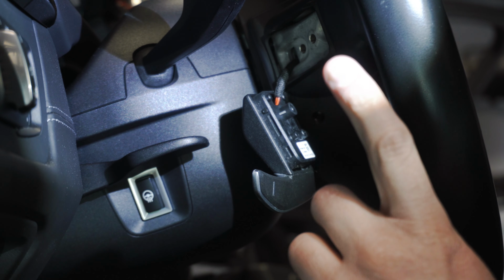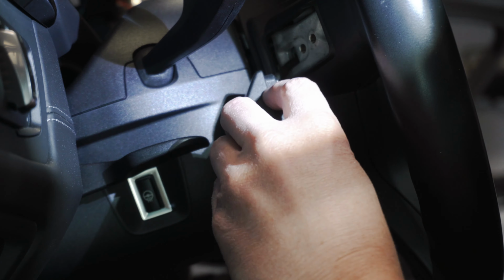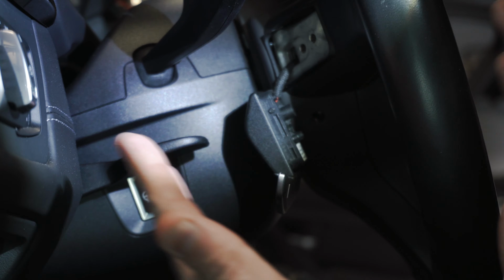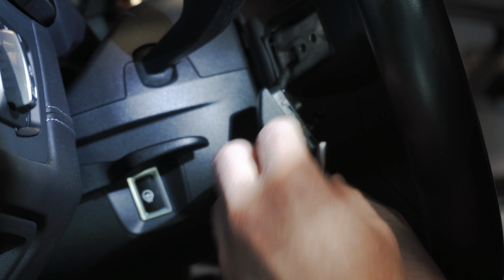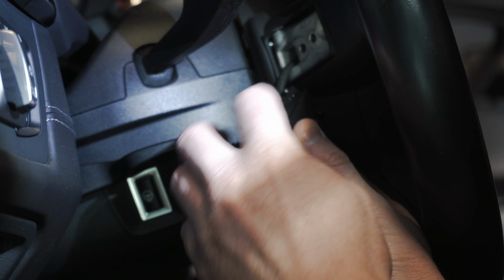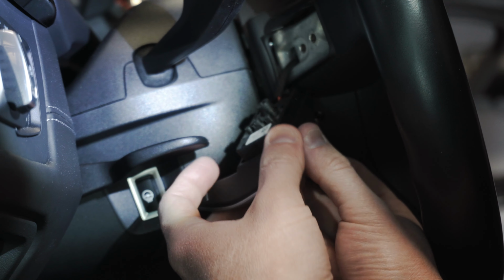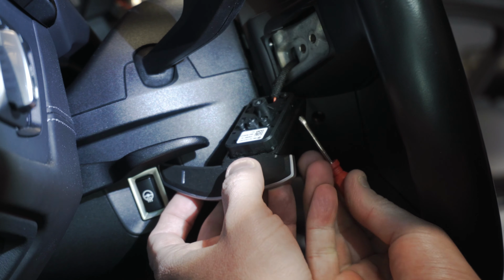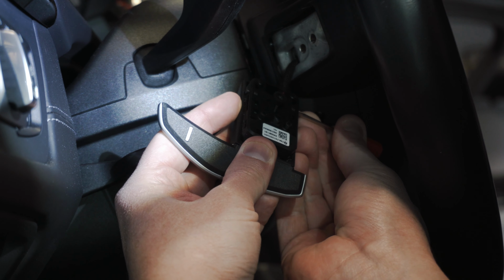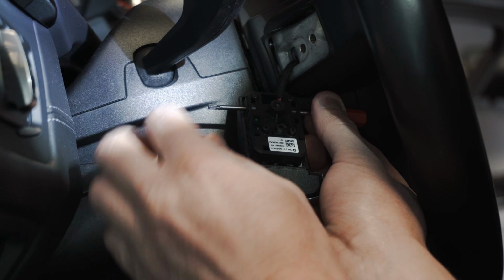Like I said, I'm gonna do the driver side or the downshift paddle first because I can get the camera a lot closer and because the angles are tight. So it's just kind of dangling here. To separate this paddle shifter, there's just a plastic bar. You'll see a little circle right there and a little circle right there. The smaller circle, this bar only goes in one way. It only comes out one way. So you're going to take a little pick tool, find the smaller side, and just push this bar. Since I can line it up here, you'll see that it just comes out like that.